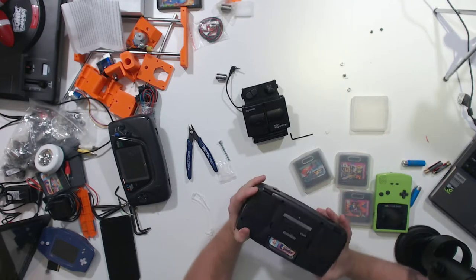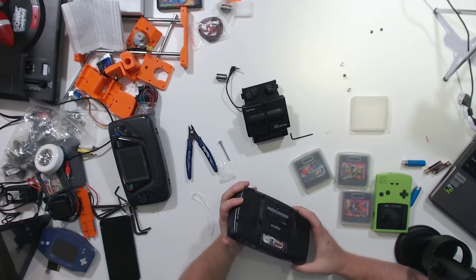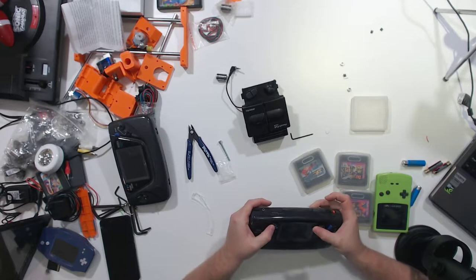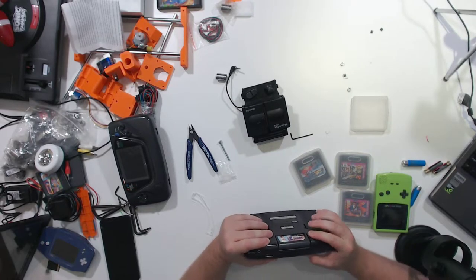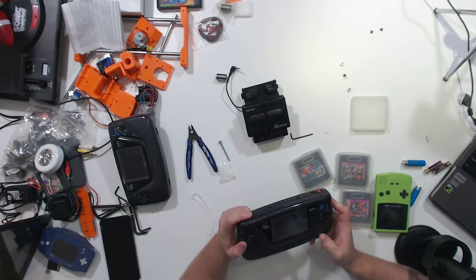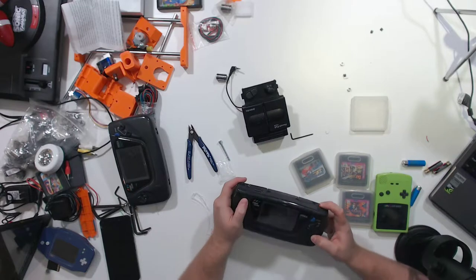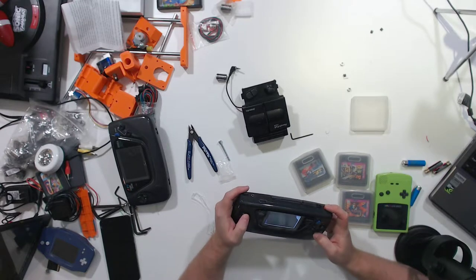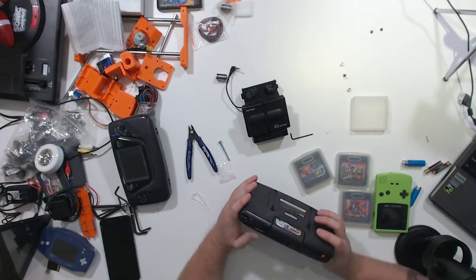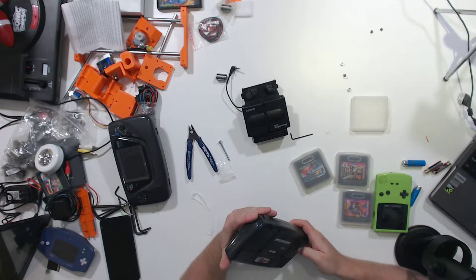I'm going to go ahead and turn it off. I don't see any physical damage to the outside of the case — there's no weak spots or anything. I legitimately don't know how they managed to crack the screen without damaging the outside of the unit. The backlight looks bright and the sound is good, which means the caps are good. I wonder if somebody pulled this apart to do a cap kit on it, broke the screen, and then basically just tossed it to Value Village.